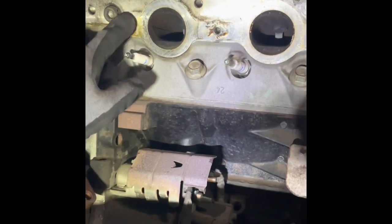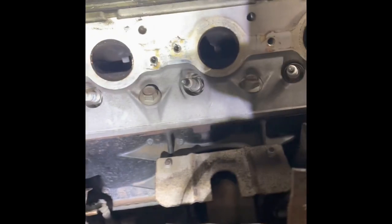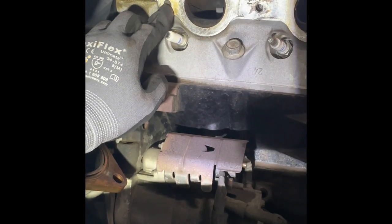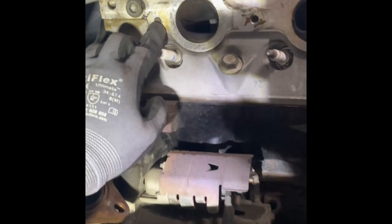First step, I'm going to try to clean this off real quick. After that I'll shoot a little bead right on top of the nut and the broken stud — weld it real quick — so you have some surface. Once you put this broken nut on, it'll bind to it.